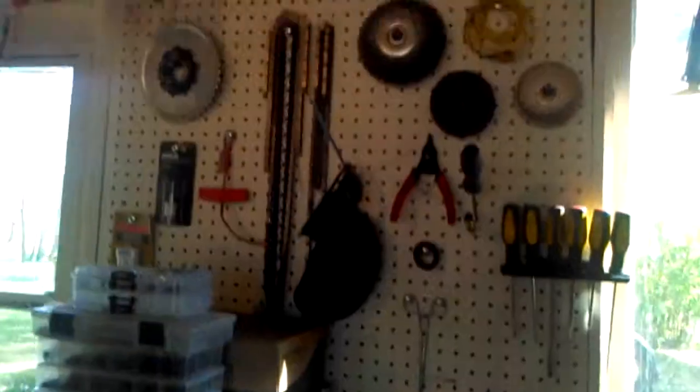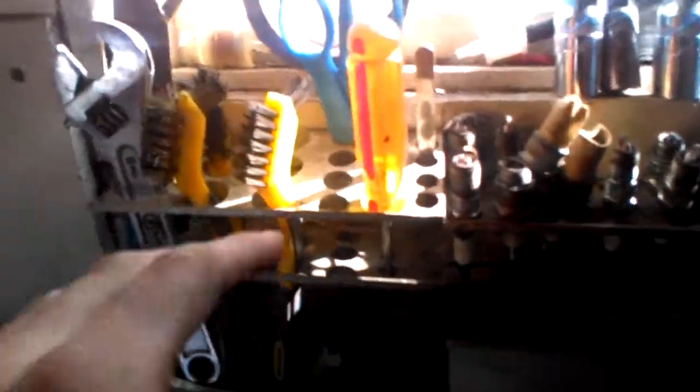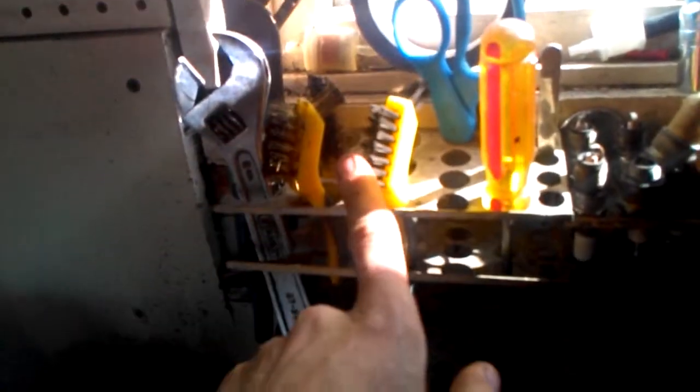Along with your sockets, you'll need a good set of tools — pliers, tin snips, mallets, drivers, cutters, ratchets, and all the generic stuff. I have specialized tools too — gear pullers, harmonic balancer pullers, all that fancy stuff — but the average home mechanic probably won't need all that. In your work area you want everything easily accessible. I have three brushes here: steel, brass, and nylon. The reason for three different materials is so you use the one appropriate for the job — you don't want to be scratching paint or metal, but you still want it stiff enough to clean the area.